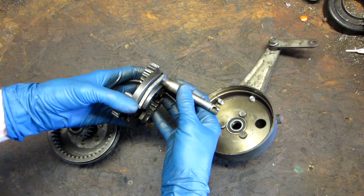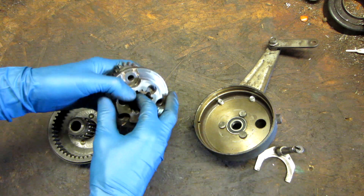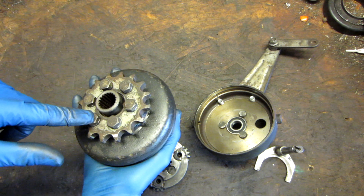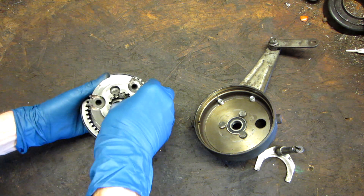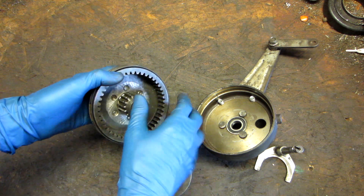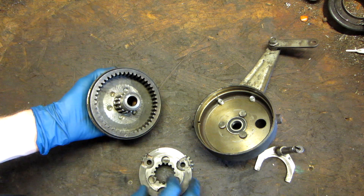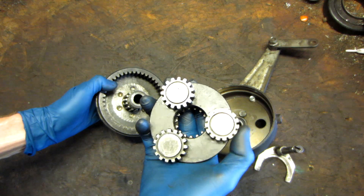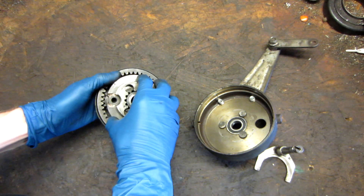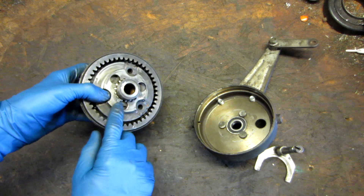The fork engages with your planetary gear set like so, so that it can move back and forth while still being able to rotate. Over here we have our ring gear, which is also connected to the output sprocket. The planetary gear set goes in just like that. The input is allowed to rotate independently of this housing and the ring gear and all that, but it's got teeth on it. Those teeth have two purposes: number one, they mesh with the planetary gears, and number two, the very ends of them actually will mesh with the teeth in the actual planetary gear set carrier itself.